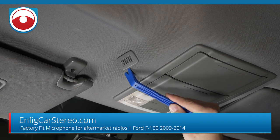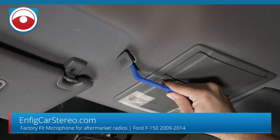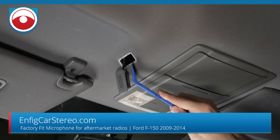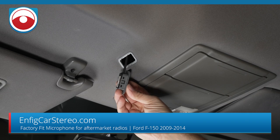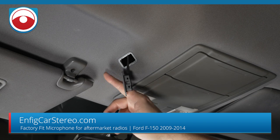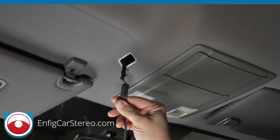You're going to go in here and look, and then when you see it you're going to put the pry on the outside pushing in on the metal. This is a very, very thin piece of metal so you don't want to be rough with it. Now this is actually the microphone inside of here — this piece of plastic holds the microphone. Sometimes this is taped so when you pull on it, it comes out nice and easy, but sometimes you've got to give a little bit of a tug.